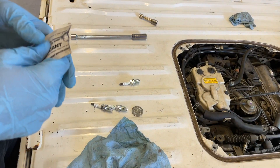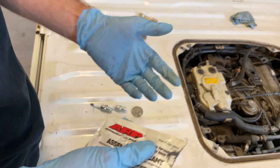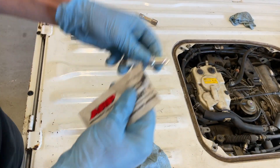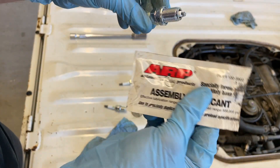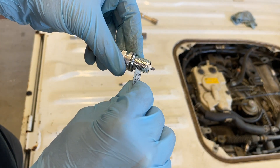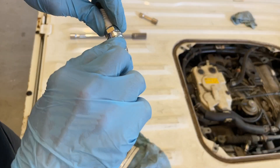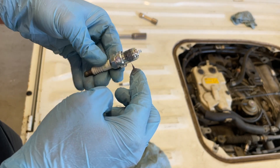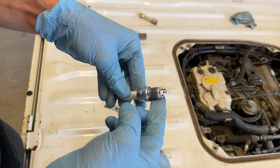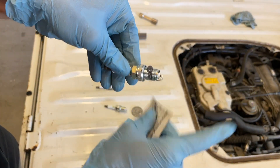As the kids mentioned earlier, it's always good to start whenever the engine's cold. Never try to remove threads out of a cylinder head whenever it's warm — the whole metal expands, thermal expansion. Things get tight, threads strip out. So when we're going back in, I like to use a little assembly lubricant here on the actual threads of the spark plugs. They've actually got some thread conditioner lubricant you can buy at the parts store. I happen to have some of this laying around. So I'll just put this on the threads because that cylinder head being aluminum and these plugs being steel — it's always a good idea to make sure your steel doesn't beat your aluminum. This will help with going in, and this will help whenever one day we change these things out when the Acti's got a million miles. So I'm just going to get all three lubed up here and then we will start putting them back in.